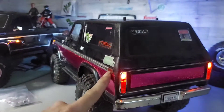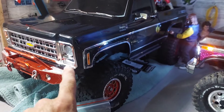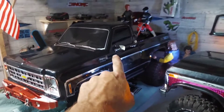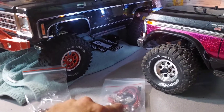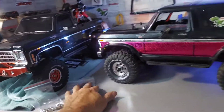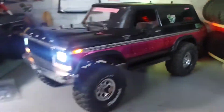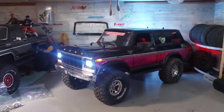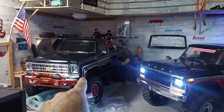The kit wired in, reached everything, worked fine. I just forgot this truck has a side marker red light, so I need to tie in some three-millimeter LEDs later. I bought two of these kits so I'm going to take the yellows off one and put them right here. I have to run them to a plug and connect them to the light box because I want the flashing features on that truck. Anyway, we got lights on the wife's truck all the way around.